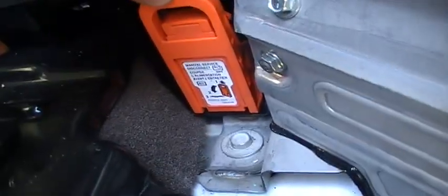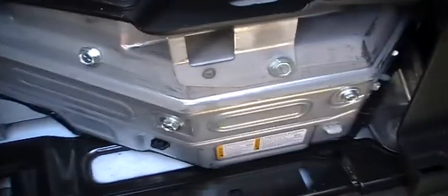It's got folding seats here, and right here is your manual battery service disconnect. Let's see if I can pull this cover off. And right there is your battery. This is a 300-volt battery pack, and right here is your service disconnect. To disconnect it, you pull this tab down and pull it out, and that shuts off the battery system. You have to give it about 20 minutes or so to let the capacitor system power down — it's different for every vehicle, but about half an hour to an hour is the average.